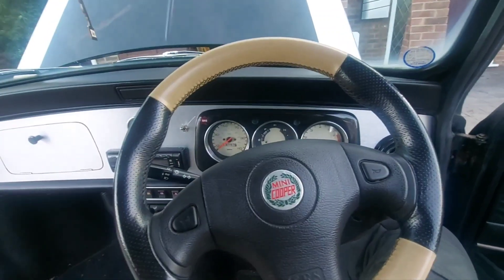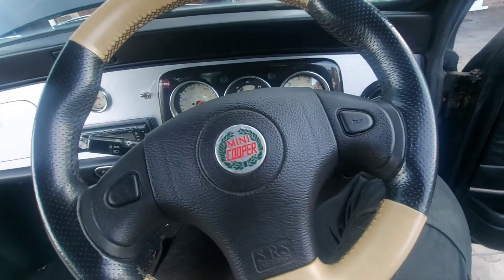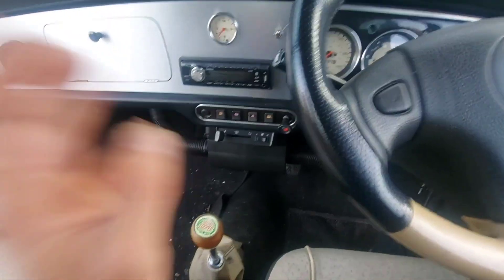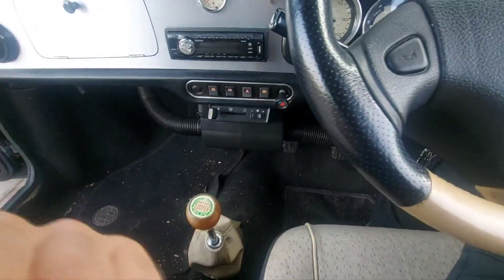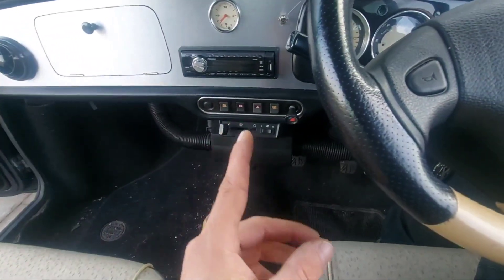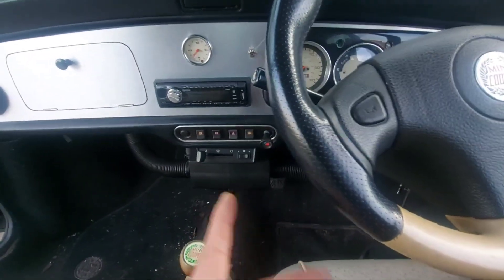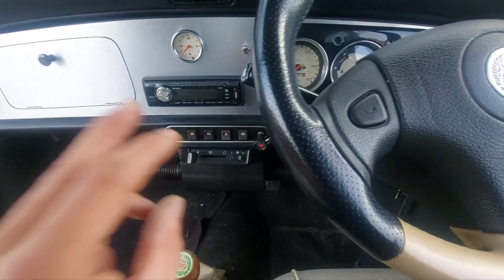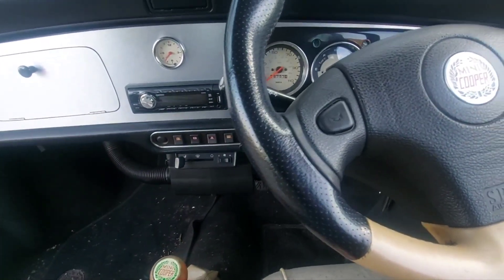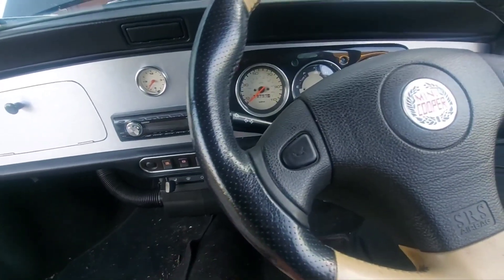Just a little more clear information now that I've had a chance to process this bizarre occurrence. With regards to the network — there is no CAN bus network on this vehicle, because as far as I can tell there's only an ECU connected. It's so old it's just the engine control unit, so my CAN bus tests aren't relevant here. It may even be that there's no CAN high / CAN low on this ECU at all — it could be a K-line or some other more basic protocol. Since I can't get the wiring diagrams, I cannot clarify that.